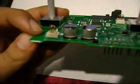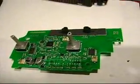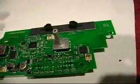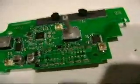To knock these out, you can just warm up a soldering iron, and you can just tap it a little bit from this side where the soldering point is, and do the same thing for the other side, and this thing should pop right out. And I believe there are actually only 3 lights. 1, 2, 3. But the way they distribute the light is actually kind of tricky, because if you look at the back of the AC controllers, they got these plastics, and that's how they transfer light, the light goes through all these plastic parts. So it's real nice, easy. Everything I gotta do is just change 3 lights and I will get white color light across all the AC controllers. So that's definitely gonna help me out.